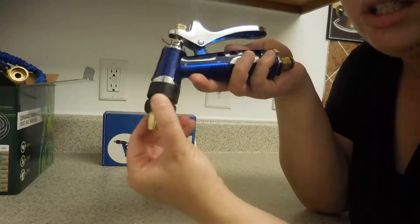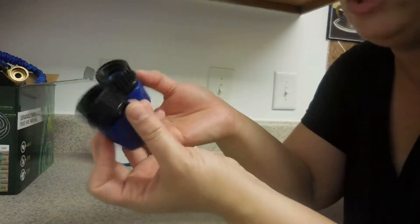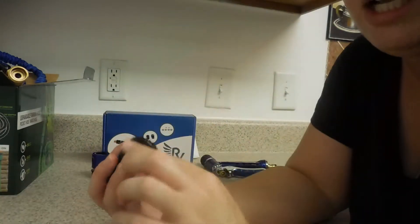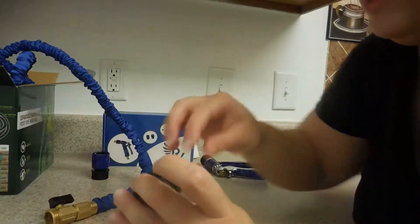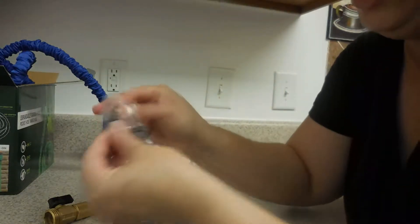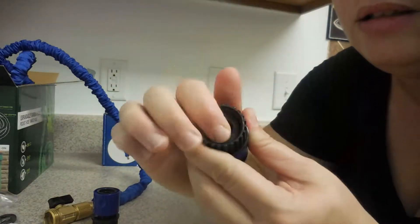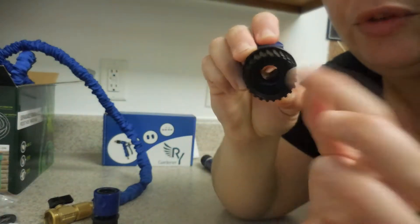You don't have to worry, you just have to adjust this. It comes with two female connectors for quick release. And let me tell you, if you have problems with this part leaking, you just have to put an extra washer — it comes with a blue one. You will take one of these washers and place an extra washer inside, and this will prevent the hose part from leaking.